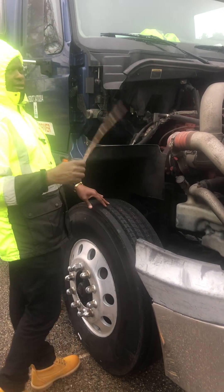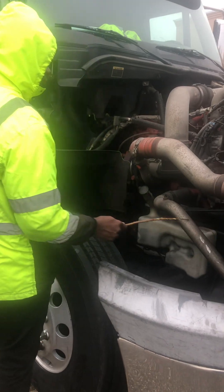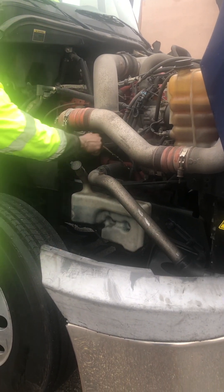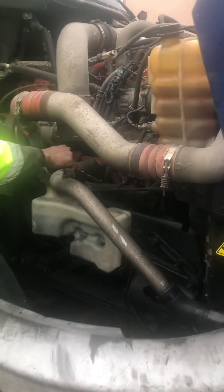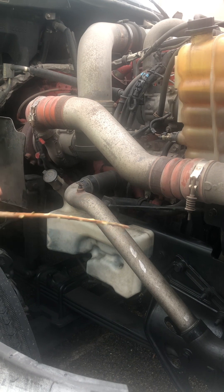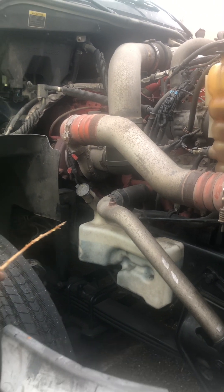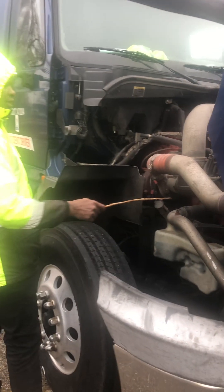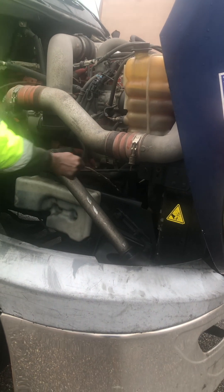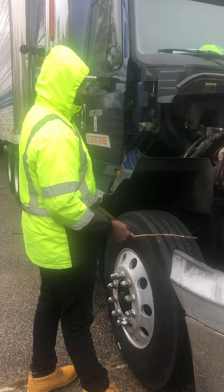I'll check my water pump. How do you detect your water pump? You look for the hose that connects with the coolant radiator that goes into the engine. That's how you detect your water pump - this hose here from the radiator goes into it. Mounted and secured to the vehicle, not bent, broken, or cracked, and I detect no leaks. What the water pump does is it cools the engine with coolant water that circulates through the radiator. My water pump is belt driven - the belt has the fan connected to the motor - so I detect no abrasion, bumps, or cuts, and no more than three-quarter inch of play.